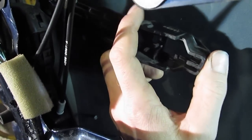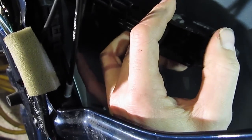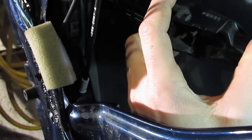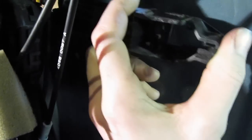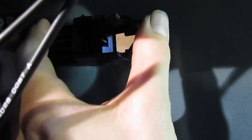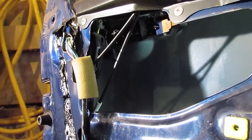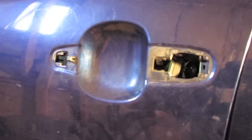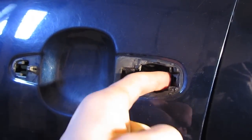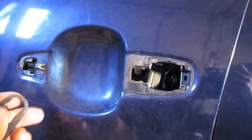Upon reinstalling the interior door lock, the metal rod over here goes into a tab — it's hard to see but you have to feel for it. Once you get that rod in, simply move the interior handle into position and you'll feel it snap into where the screw is that you took out. There's a plastic retaining piece and it should just snap into place, and once you have that it will hold itself into place until you reinstall the screws. On the outside of the door handle there's a plastic tab — line that up and it will slide into place allowing it to snap into position.